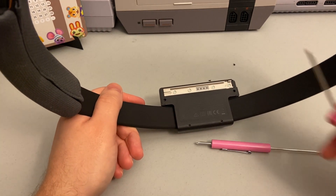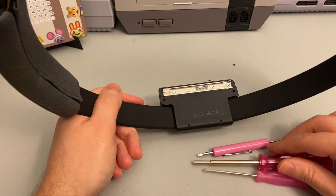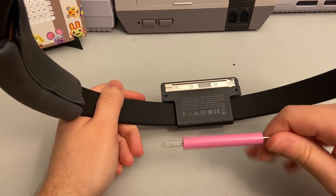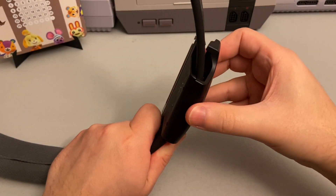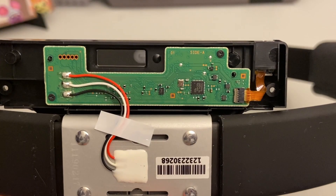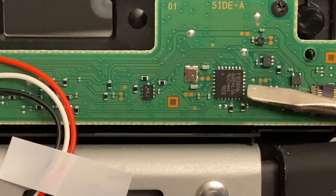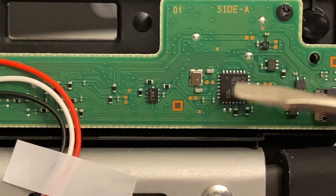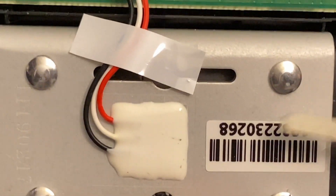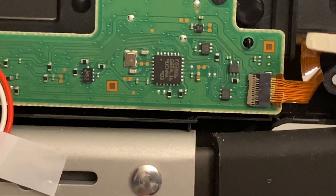There are also four Phillips-head screws found in the metal Joy-Con rail, but you can ignore those if you don't care about doing a full teardown. From here you can just pop the top half of the plastic unit off, and there's our board. On this board we've got a single chip labeled F038G6 followed by a similarly random sequence of numbers and letters. There's basically zero information about this chip online, but we can still infer its purpose — it's likely a microcontroller in charge of interpreting data from the sensor connected to the board and sending that data out to the Joy-Con through the ribbon cable found adjacent to the chip.